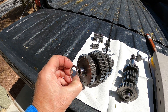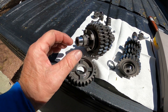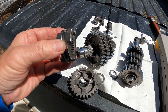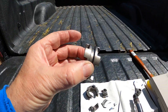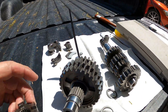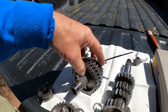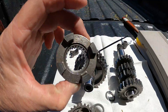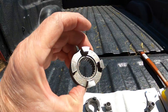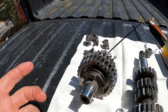The other part that got a little squirrely for me: this gear has a bushing and there's another washer, and this can go on both ways. You look at it and there's not much difference in the dog sizes or the gear set. However, if you get this in the sunlight, you can see a snap ring and there's a washer behind that snap ring. So in order for this dog slider to go on properly — you can see that that side is not recessed and that side has a recess. So this recessed side goes up against the snap ring and the washer. That solved that mystery.